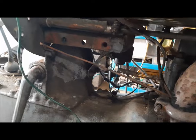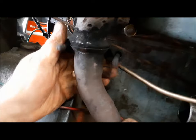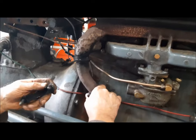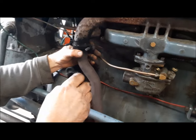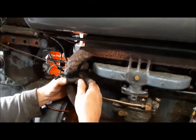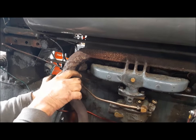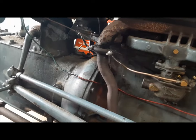You can see here we've got this spring compressed by pushing this along a tightening clamp, and now our throttle stays where we put it — that should be a big help. Now I'm pursuing this big exhaust leak. Here's the problem — this clamp is not holding this pipe tight against the manifold, mostly because it was on upside down, I think. Let's try it this way. Yeah — see there, it's just loose, and if that's loose it's going to leak.